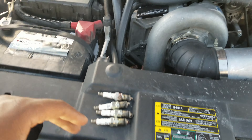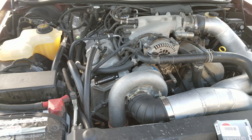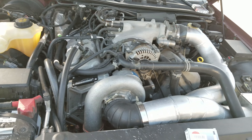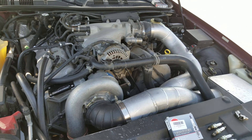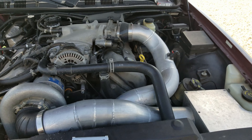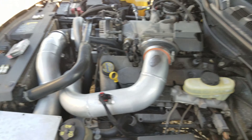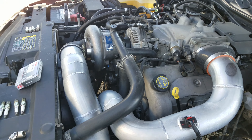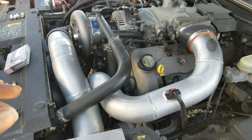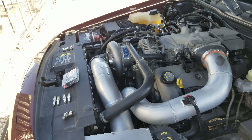If you're going to use coils on a modular motor ignition system, always use stock coils. Don't use MSD — I've had bad experiences with Screaming Demon coils, both coil-on-plug and the EDIS setups for '96–'98 and earlier Mustangs before they went to coil-on-plug. Avoid aftermarket selections like AutoLite; they're just not good. Stick with OEM.